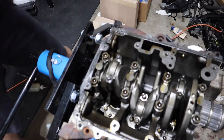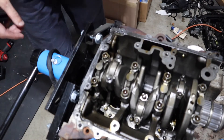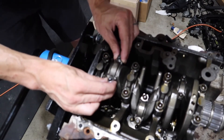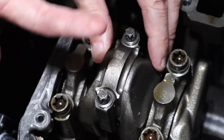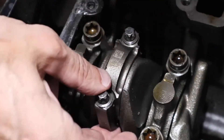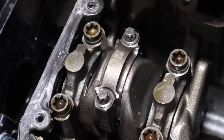Now we repeat that torquing process. An old wise mechanic taught me this: once you've got it torqued up, always check for rod end play. You can see I've got a tiny bit of end play — that means nothing's bound up, no debris in there causing binding. So this one is good to go, done and torqued. Now we just need to do the other three.